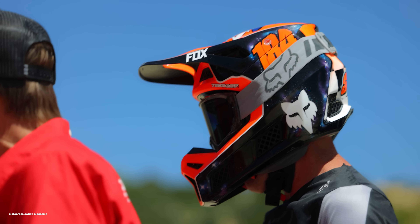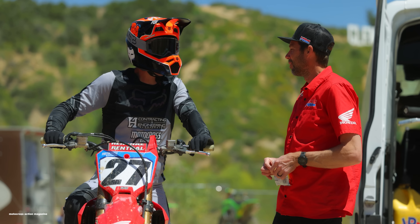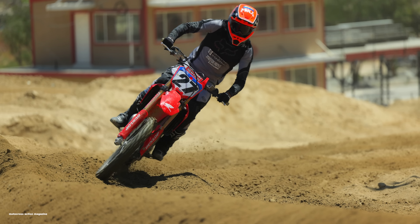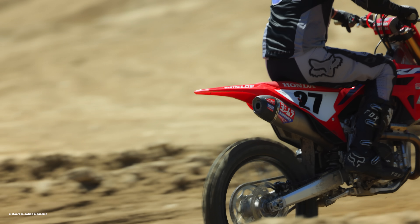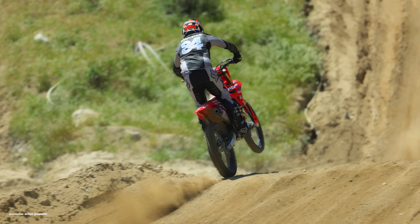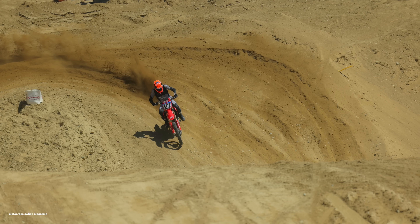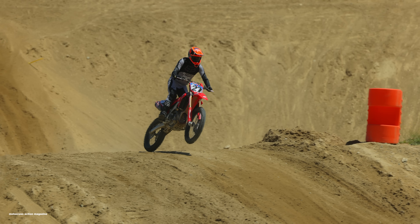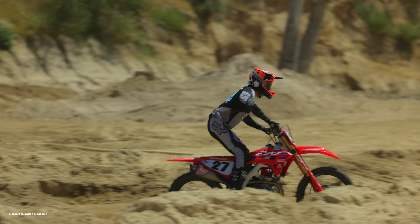Well, overall we raced here Sunday and I rode the 2023 450R standard bike. Coming out today and jumping on this bike, it's a big difference in the handling department. The shock is definitely a lot firmer rolling onto high-speed straightaways with big rolling bumps — a lot more bike control and ground feel when you're accelerating hard. It allows the rear to have a better hold-up and lets you cut back and forth where you want to be placed on the track. The forks have a better crust feel than the standard bike, with a more readable ramp-up at the bottom of the stroke, giving you more confidence to ride harder down the hills.